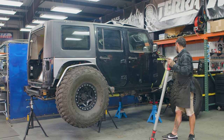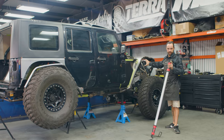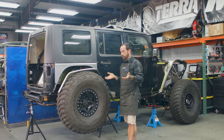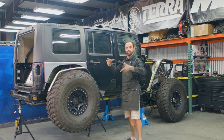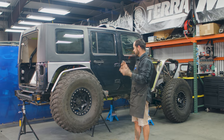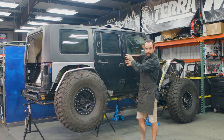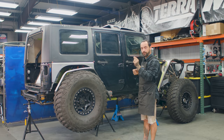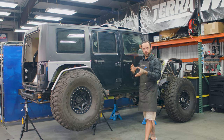That's what they're built to do. The front is a different story — where the powertrain is, from almost the fender forward, that's an extremely rigid area that's not going to move. But some of the rear stuff is still going to twist and articulate. What we wanted to stray away from was the typical fashion of tying things in, because we're so used to building vehicles that are fully caged and rigid. Since we're banking on this thing articulating and flexing, we wanted to float the sheet metal just on the cab and leave the chassis section pertaining to the chassis and frame — so they're not tied together.